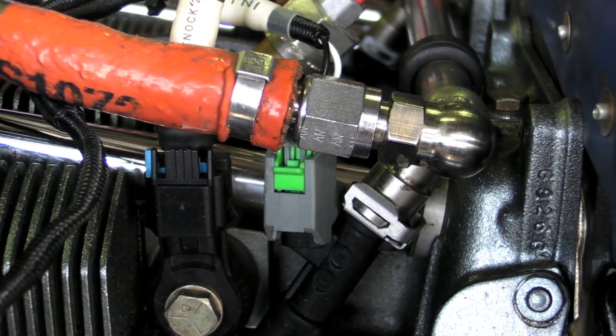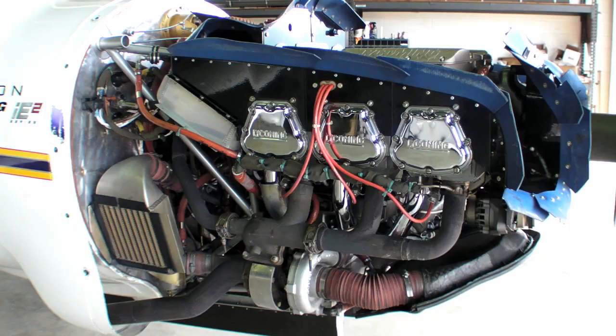Those are the four main actuation systems in the IE2 engine. Each individual cylinder has its own fuel injector and the fuel for that cylinder is scheduled on an individual basis. We measure the air flowing into the engine, calculate for that cylinder the correct amount of fuel for that airflow and engine RPM, and control the fuel injector directly to put the correct fuel mixture into that cylinder.